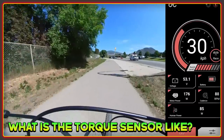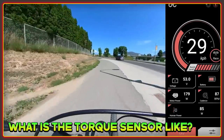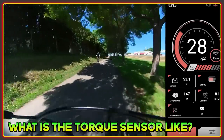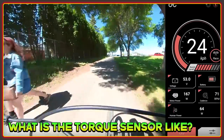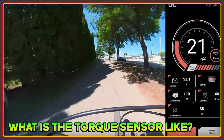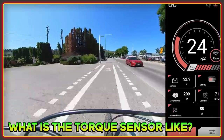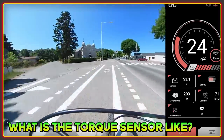If you have the setting activated then as soon as you put pressure on the pedal it delivers power, and this is great. It means it's really easy to get going from a standing start even on very steep slopes. If you're used to cadence-based assist systems then this will be a huge improvement over them. It makes riding in hilly towns much less dangerous as you don't have the wobble phase when starting off from a standstill on hills. I've not really used the throttle on my bike that much because the torque assist just provides so much of a better feel. I don't need the throttle to safely start the bike moving like with cadence-based assist.